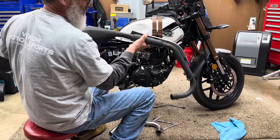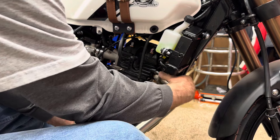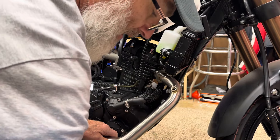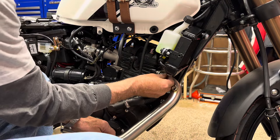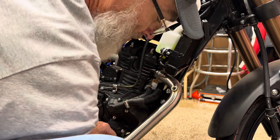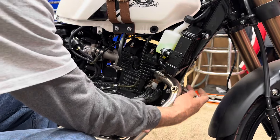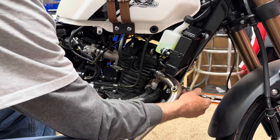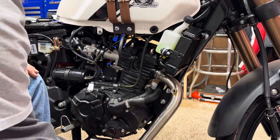Let's get rid of the old one. Now we'll start this head pipe in here — make sure everything lines up, and it does. I've determined I'm going to need about three washers on here, so we'll put three washers on each stud. I've got three washers on each one. I'm just going to loosely snug this so I can still move it — just going to do it by hand without a ratchet.